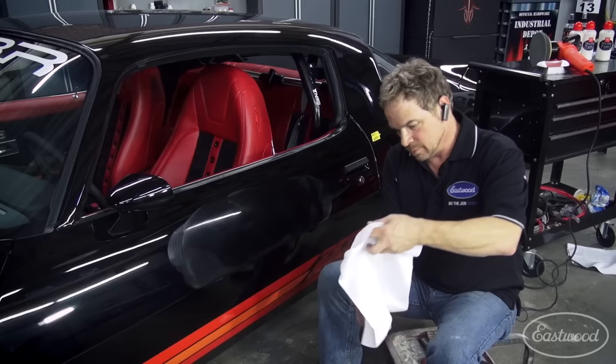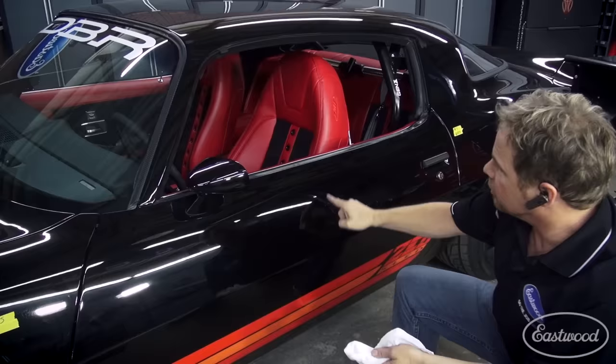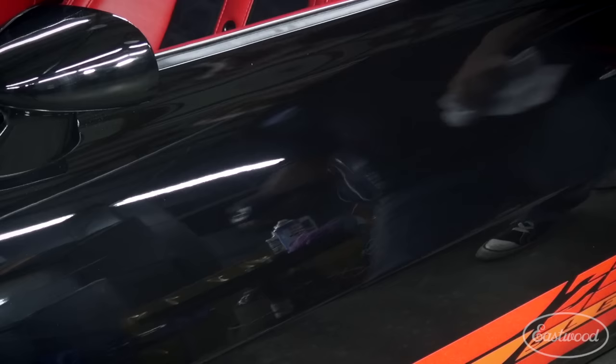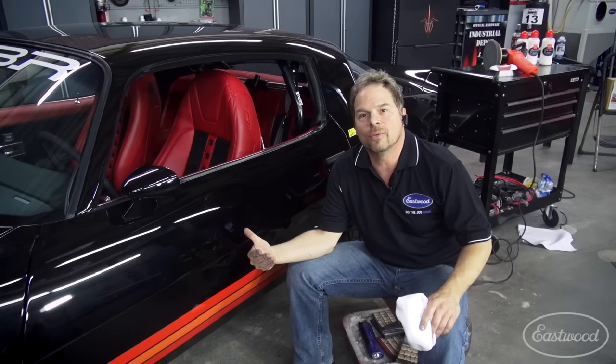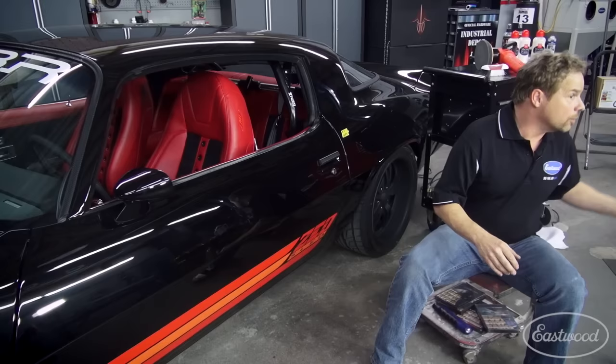For the sake of this demonstration, I'm just giving you the quick and dirty on it. Now with the carnauba wax and a clean microfiber, I'm going to get my light and show myself that I've done the job. I'm not seeing the holograms and halos that I was seeing before. Two steps after the paint's cured — you can get rid of swirls on a black vehicle. Use the dual action buffer, don't use the rotary buffer. The Griot's Garage tool is available on the Eastwood Company.